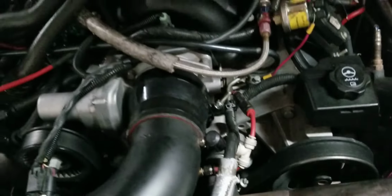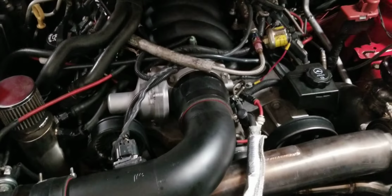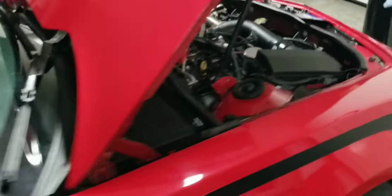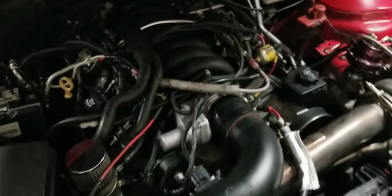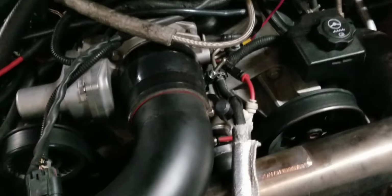And it's got dual nozzle. See down there, it's dual nozzle water meth. Well, just it's straight methanol injection. It's 100% methanol. It is on E85. This here is actually aligned to a secondary fuel pump that I have. Yeah, right there, you can see it. That is not a kit, I made that myself. I'm not gonna spend $1,000 on a kit that allows me to run a Bosch 044 down on the frame when I'll make it myself. That's ridiculous. You can see there, it's got a flex fuel sensor. Like I said, it's a flex fuel, but right now it's on pure ethanol.